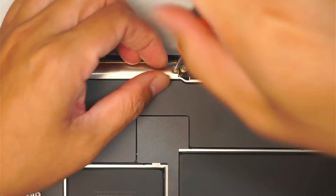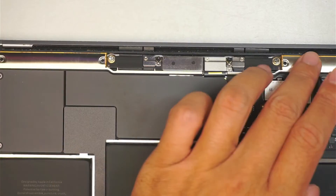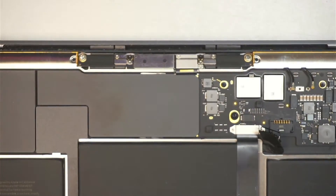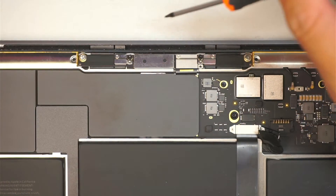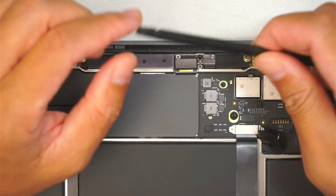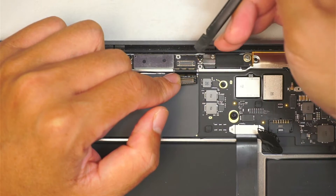I just removed four screws which are holding down the Wi-Fi antenna. So this whole bracket here is the Wi-Fi antenna, except for this little display board. Next step, using a T3, remove the tiny little screw and remove the bracket. In here you want to use a plastic prying tool to go underneath the flex cable and kind of lift it up to pop it open. They are just like Lego — you need to get in between the connector and just lift it straight up.